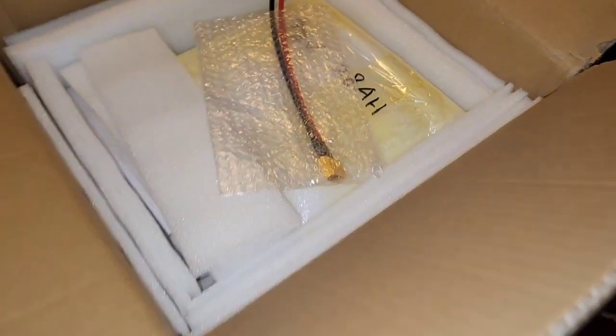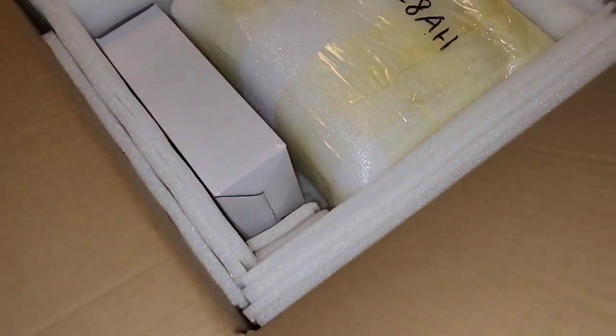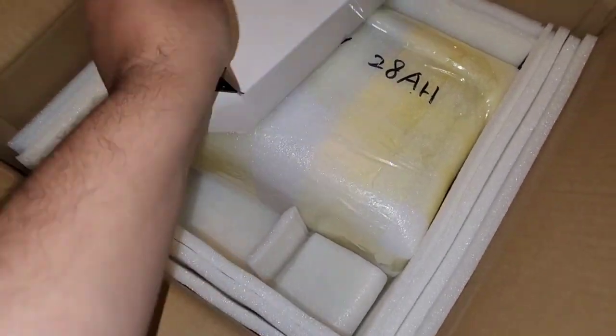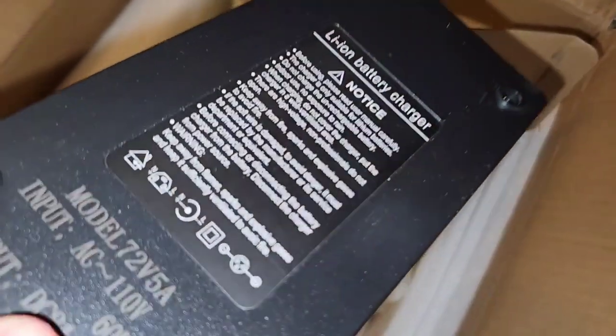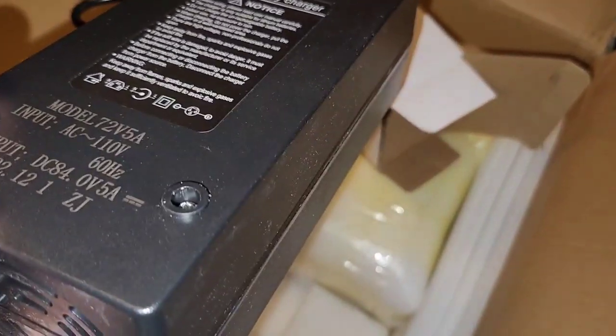The biggest change is this 72 volt 28 amp hour custom battery that I got made overseas. It came in right before our ride out on Wednesday nights here in Orlando and we're just doing a little unboxing here. It arrived surprisingly in two weeks and even came with a 5 amp charger, which is pretty sick because usually when you order these batteries, they don't come with anything like that — some extra connections and the battery charger. It looks to be only a 5 amp charger, so I'll definitely upgrade to a 10 amp charger to get those charge times down lower, but it's still really sick that it came with this.